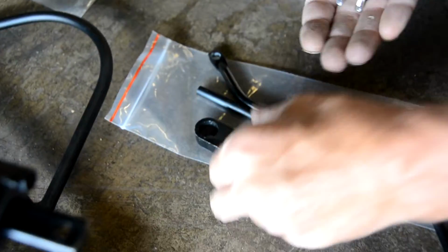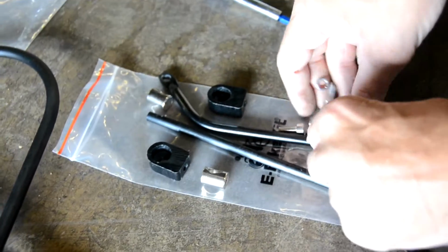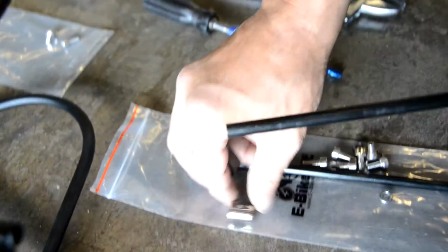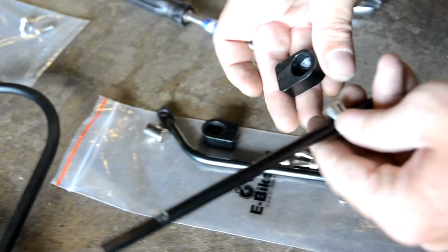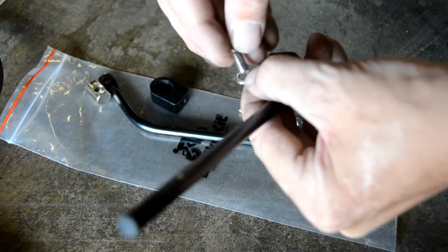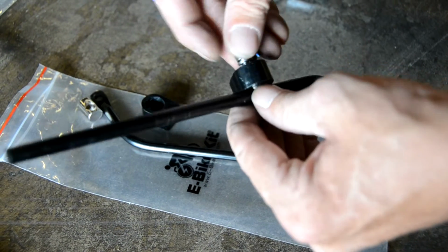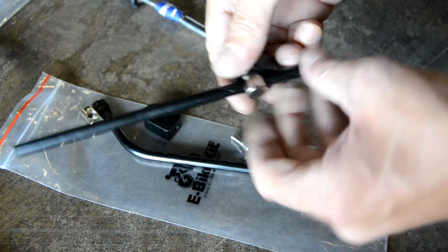So these rods will connect to those blocks, and that will connect it to the rack and the bike. Now with the rods, you'll take the draw bolts, the silver cylinders, slip that onto the rod, and then that connects the block. And under the head of the screw, we want to be sure to use the split washer to keep it from vibrating loose. And the screws are actually sized for the washer, so it's not going to tighten up right unless you have the washer. The screws will end up being too long.